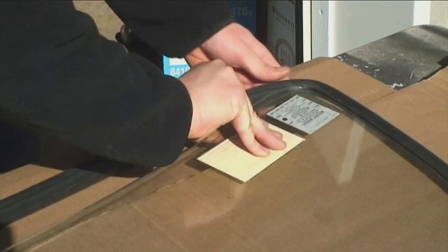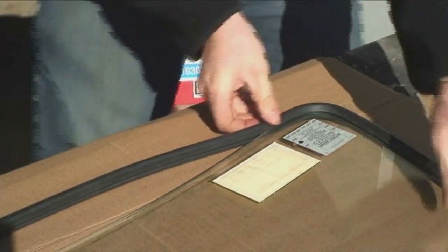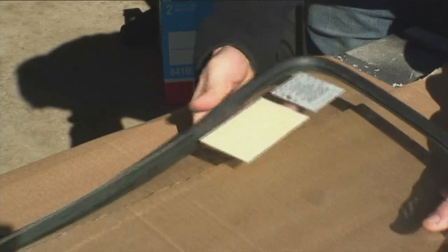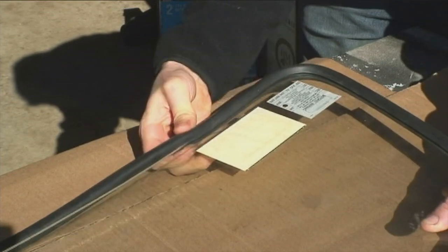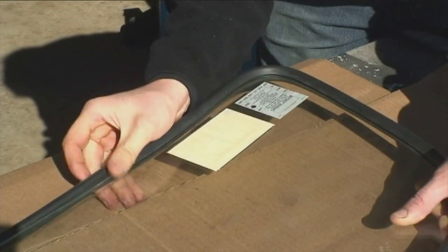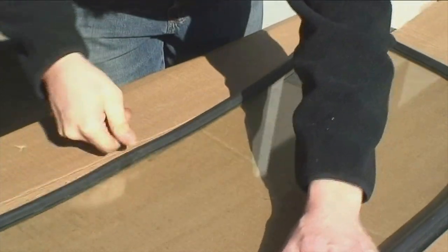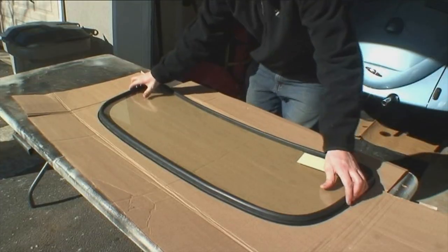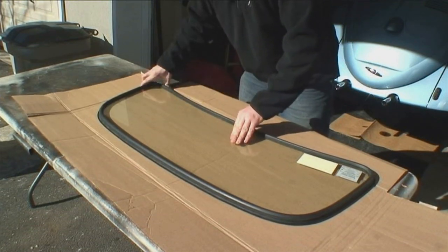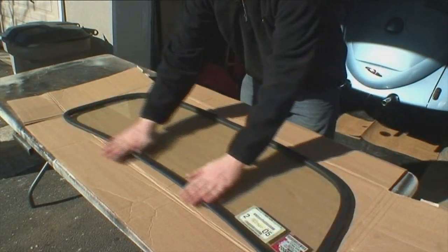You can look closely here — sometimes I get the top portion of the groove on the window and then pull downward to open the seal a little bit to get the seal on. This is the way I've been doing it for a while. In the beginning it might be a little tricky, but you pretty much get the hang of it. Take some time, go slow, no rush. Make sure the groove is all the way on. Some of the Brazilian seals that are really tight will start to bow and the seal just won't stay on the glass. These West Coast Metrics are actually really good. Make sure the fused section is at the center bottom and the seal is all the way on.